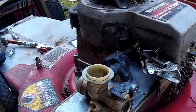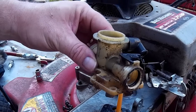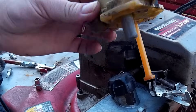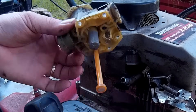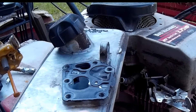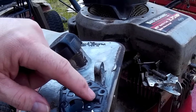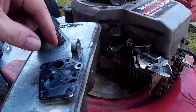Now all you have to do is lift the carburetor up. Don't snatch it up because you may catch that little pickup tube — just work it out of there. You don't want to break that pickup tube off. The carburetor on this thing is very basic. This is the diaphragm — I'm poking my finger there — it's very loose and worn out.